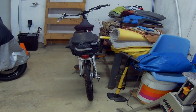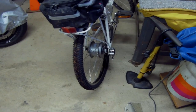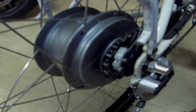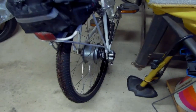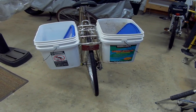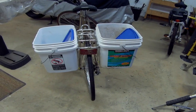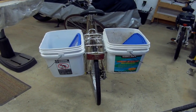Well, I got all of the gear back on, and I took it out for a ride, and it's interesting with that shiftless, constant velocity, but I'm pretty sure I'm going to have to go right now. It came with a 17, and I've got plenty of top end, but I don't want top end. I want low end, so I think maybe I'm going to change that out and get a 19. Give me a little more low end. That's what I was wanting this whole thing for, so I could use my homemade panniers here to carry some bigger loads, like maybe bring some scrap firewood home along my path. A little bit every day adds up to a big pile, but you can't do that.